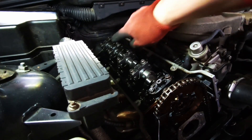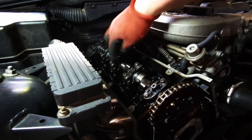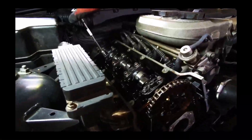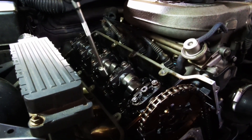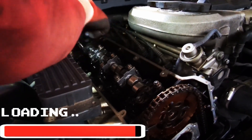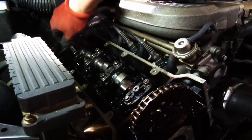They're all hand-tightened in. What I need to do now is evenly bolt them down with my ratchet, again starting from the inside and out, because the lobes are going to press on the rockers at some points where valves are pushing down. Going slowly and evenly to apply pressure evenly on the rocker arms. Whenever I feel resistance and it's getting tighter, I stop and move on to the next bolt, then switch back and forth.